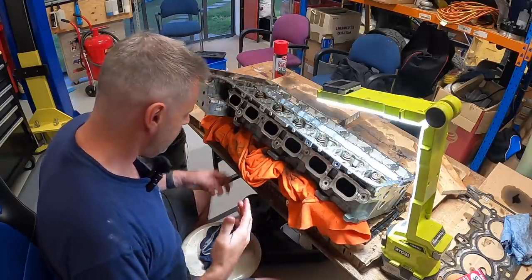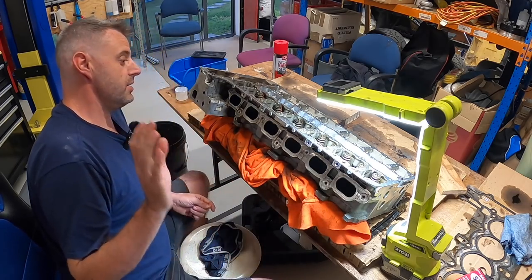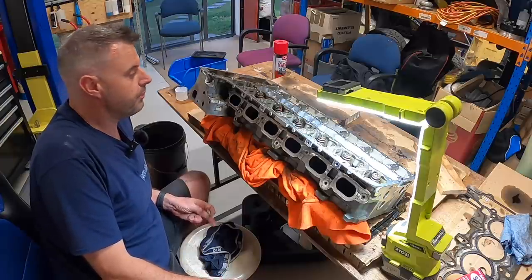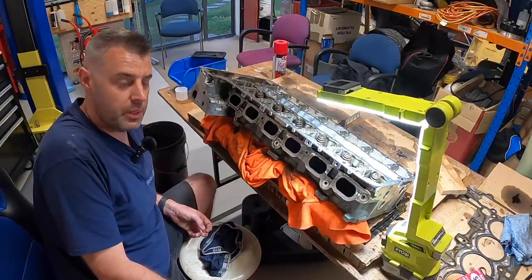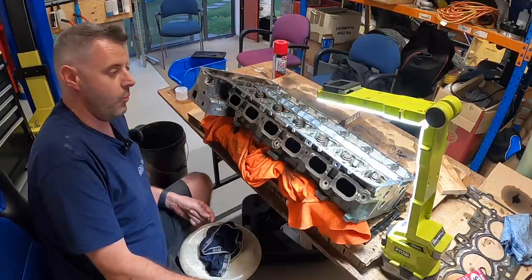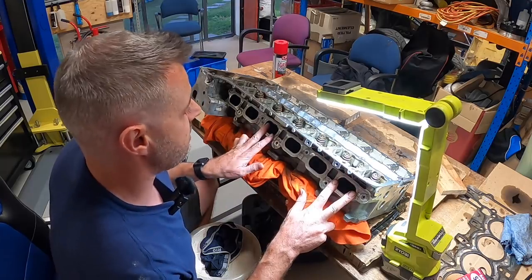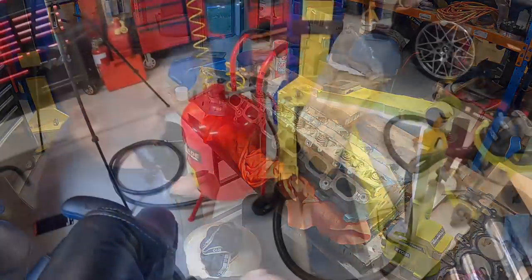You need much more finicky brushes and bristles to get right down around the valve. I was trying to chip it away with a long screwdriver but it's not the sort of thing you want to be stabbing your valves with. I'm going to let it dry off a little bit because we don't want to be pumping walnut in while it's wet, then I'm going to walnut blast cylinders six and three — the two worst ones — and we'll see how long that takes.